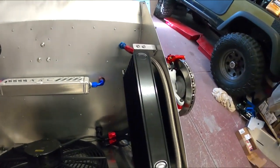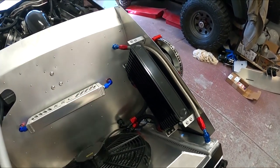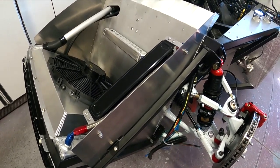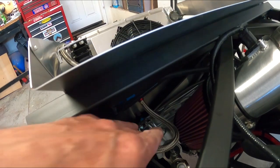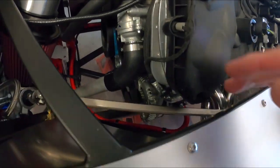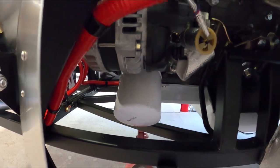I've also got my oil cooler. I debated this for quite a ways. I've got dash-10 fittings — they go into a bulkhead fitting down here and come up into both sides of the oil cooler. I don't know how much airflow I'm going to get in here or even if I need it, but if I do, I can either put a fan on here to pull air through, or cut a hole and run a NACA duct up underneath the front skirt to pick up some air. The bulkhead fittings are down below the rack. If the motor does need more cooling, I'll run the hoses down along the bottom and tie into the oil filter, where I'll have a sandwich-type diverter valve to divert oil up to the oil cooler. I never needed it on the road car — it never got hot — but this thing will be on the track, so you never know.